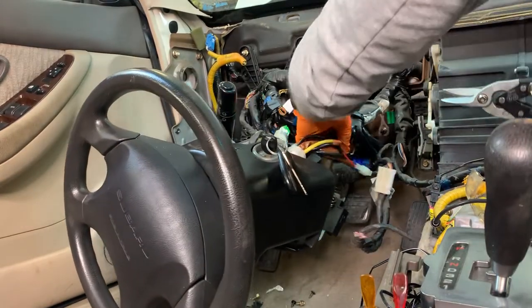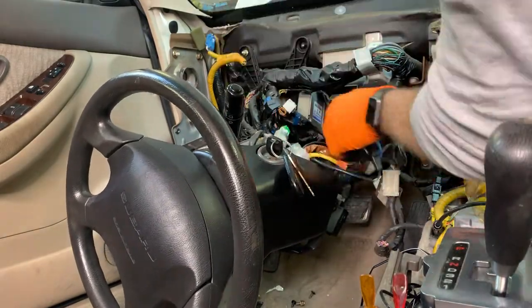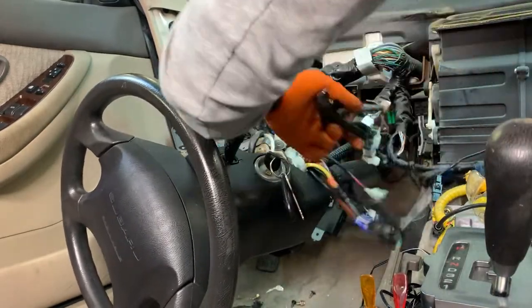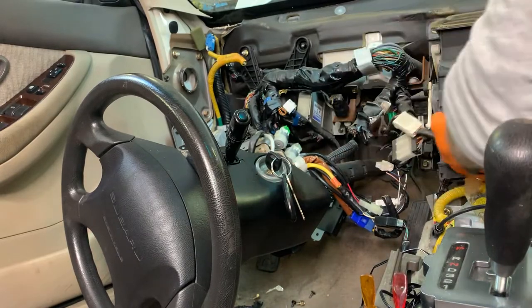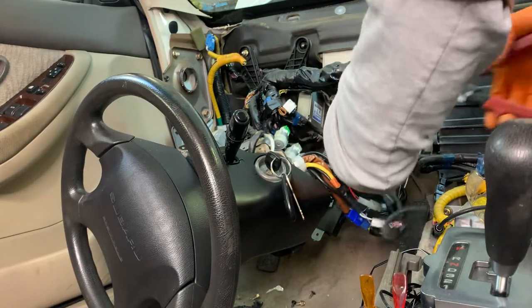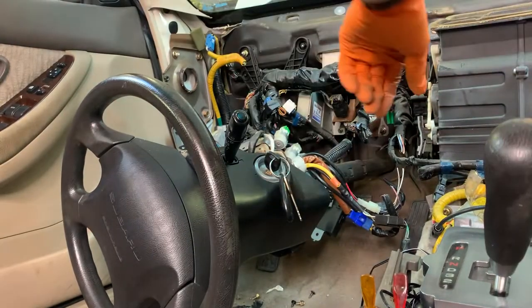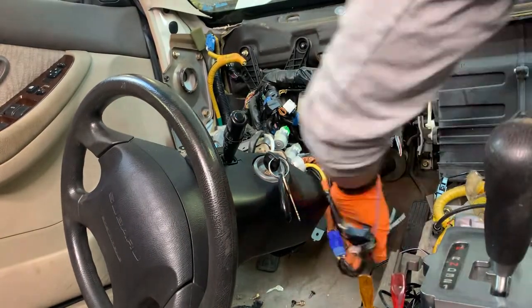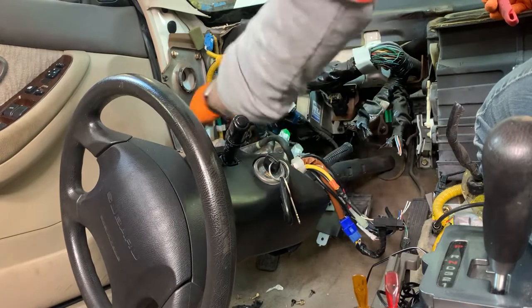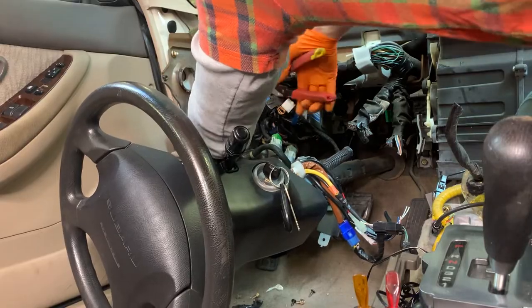All right, steering column. Lots of garbage. Don't need any of this stuff. There we go. All the column stuff separated in three. This stuff, don't need. This is all just going down here. So I'm actually going to pare this down even further, so I have less to worry about later on. Now I'm not cutting anything going to the fuel pump relay. I'm just cutting some of this stuff going to that super multiple junction and other places I don't care about.